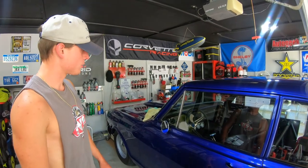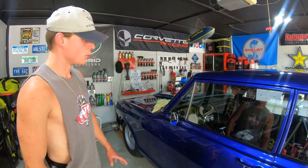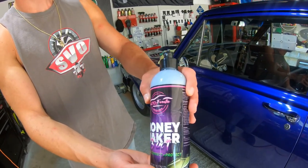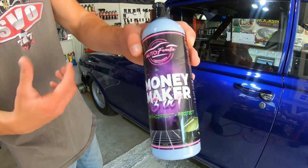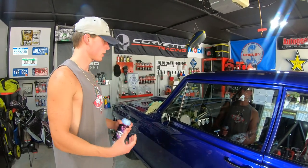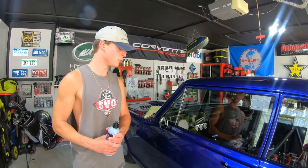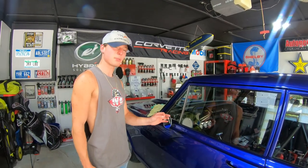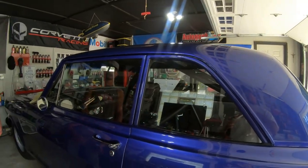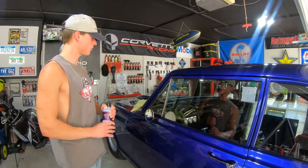Last night I got through polishing most of this Chevy 2. This was one of those cars where you have to test a bunch of different spots and try different products. I started out with the Moneymaker 3-in-1 by Auto Fanatic — it cleans, corrects, and protects the paint — and it was working great on the swirl marks. But looking at it in different lighting, I started noticing a lot of deeper cuts and scratches. The paint was in worse shape than I initially thought, and the Moneymaker wasn't cutting enough for what I needed.